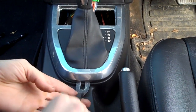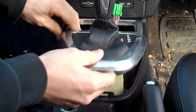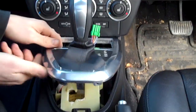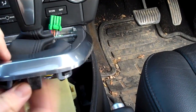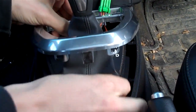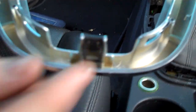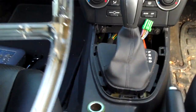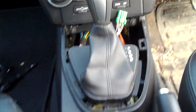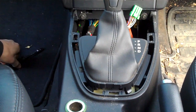Can we pull the chrome piece? The easiest place to start is at the back — there's a single clip at the back, so that frees it off. You've got to separate the black piece from the chrome. It has an electrical connector on it, so that stays in place. You've got a single clip at the back, then two side clips to lift, and two locating dogs at the front — so it hooks in at the front and you hinge it about that point.